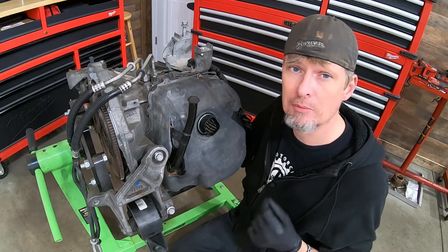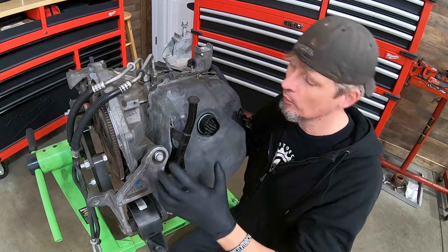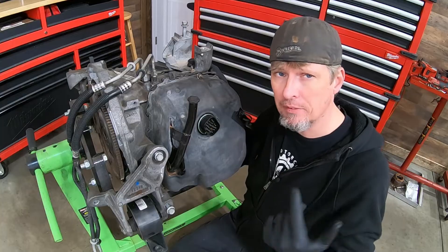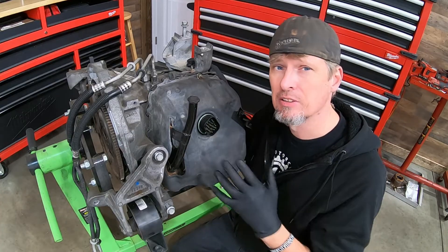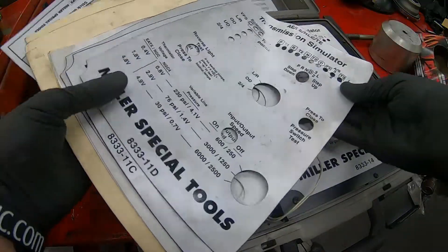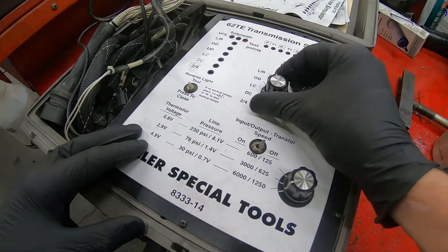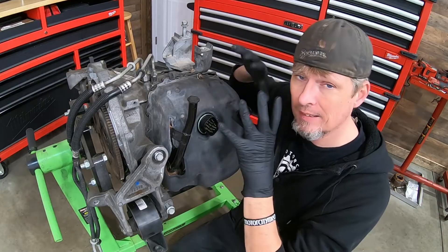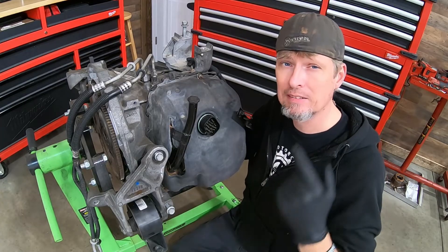What we're going to do today is I'm going to show you how to actually measure the resistance of specific pins on this connector right here. This connector goes directly to the solenoid pack — it's part of it. We've got a metal pan that encases it, and it's bolted to the valve body. At the dealership, the main way you'd test this is with what we call a transmission simulator — a plastic box with different adapter harnesses, knobs, and switches. You use a scanner to command things on the simulator and watch for lights to blink, or command things on the simulator and see if it shows up in the data on the engine controller. Basically, with that trans simulator, we're eliminating the physical transmission by unhooking all the electrical connectors and plugging into that box.